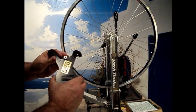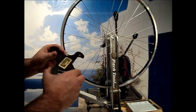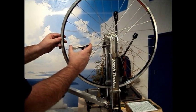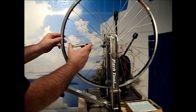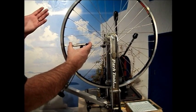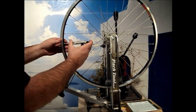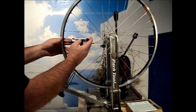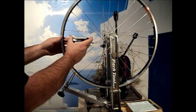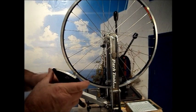The way that it works: they all have some sort of a spring assembly in them, and what they do is actually measure the deflection of the spokes. The deflection will be greater at lesser tension and lesser at greater tension, naturally. So the meter will have some sort of a graph reading, dial indicator, or some means of taking a reading off it. The reading off the meter really doesn't mean anything other than just that — it's a reading.